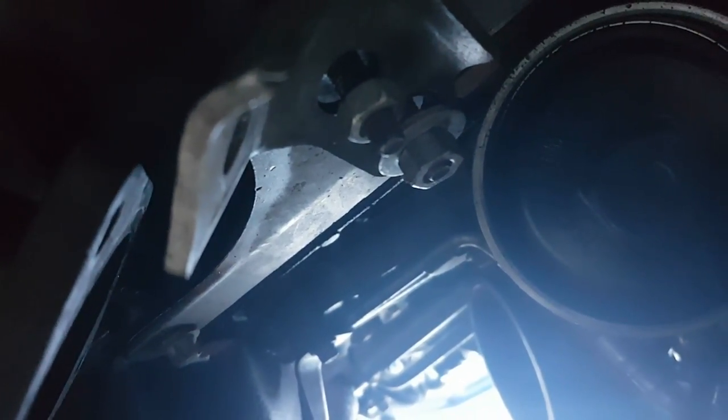Once you've removed the top bit, there's a little screw here on the heat shield — unscrew that. If it doesn't come off on one end, give it a good whack. As you can see, it's now loose and will literally just lift off and pull straight out. This is the part you'll be connecting to — you should have the old gasket seal just in here. Before you go any further, I've found the heat shield is in the way of fitting the new pipe. It's a 13mm wrench, two screws — check it out, it's right next to the pipe. Note this is on a 2014-plate car so it could be different.